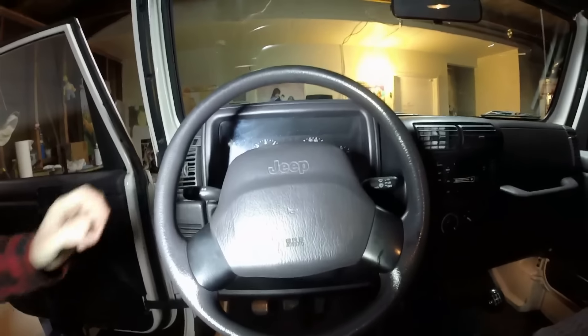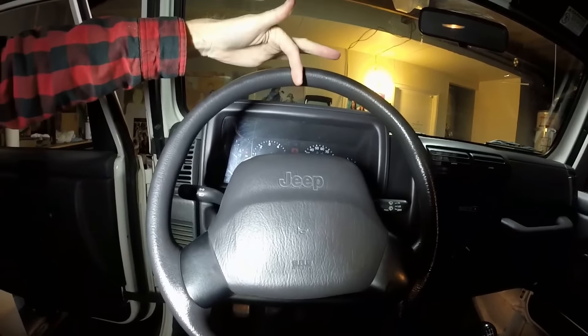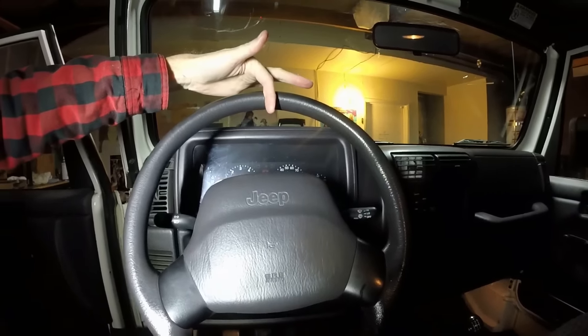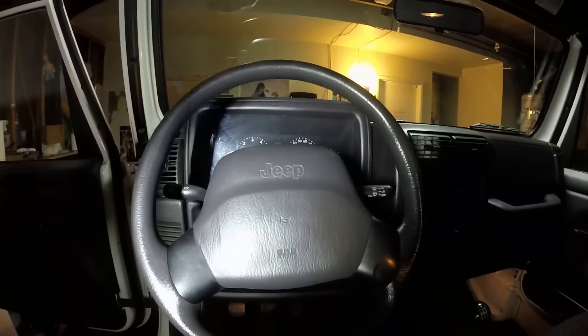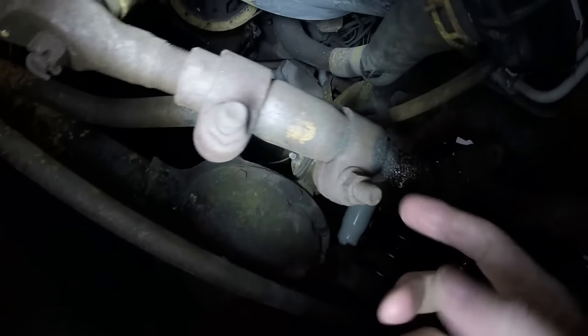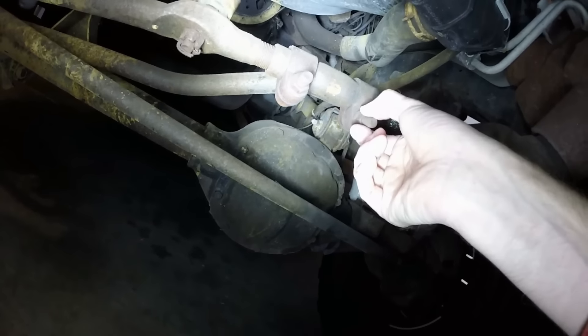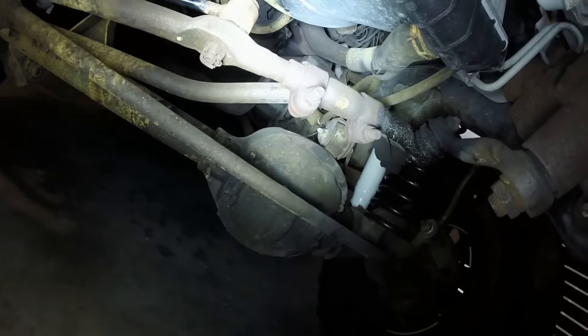The final odd and end — I drove it in straight because the steering wheel is just a hair off. I need to move it right about one inch because of the lift. First we'll tape it off. What you're looking at is called the track bar. This joint right here you can turn with one hand to adjust your steering, instead of the two tie rods on each end on normal cars, which is much harder. This is where the radiator blew and got everything dirty.